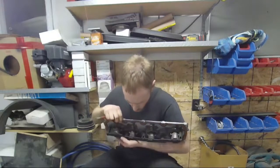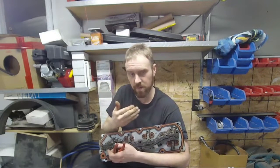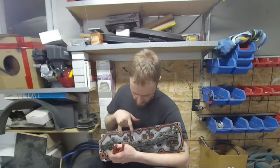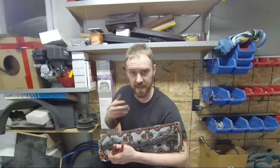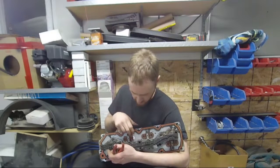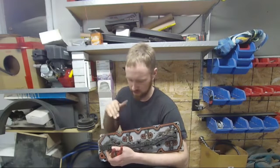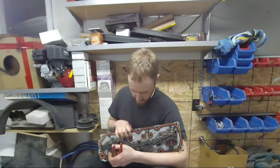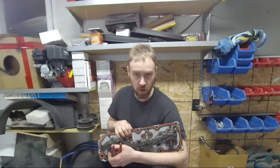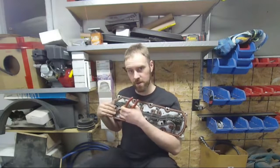And now the oil that comes up that tower, that oil pressure actually comes from the back side of those lifters as well. And when this system is deactivating those lifters, it's actually adding oil pressure to deactivate those lifters. So if you do this, it'll make sure that no pressure can build up no matter what kind of failure you might have with this that causes those lifters to collapse. It will no longer cause an issue if you have this cut and the oil galley plugged.